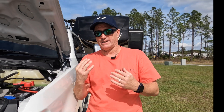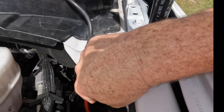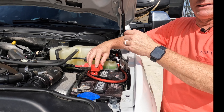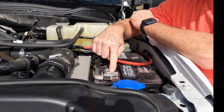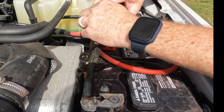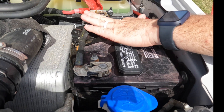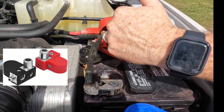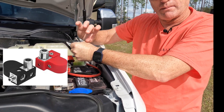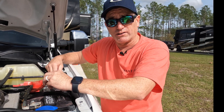Once we got over the fuel tank, it was a piece of cake. We then come up here to this circuit breaker. You'll notice on the negative post there is an actual auxiliary post for a secondary ground. I was hoping the positive would have that too, but the positive does not have a post. So I had to buy an auxiliary post that allowed me to put it over the battery and mount an auxiliary top post to it, so I was able to run the wire in.